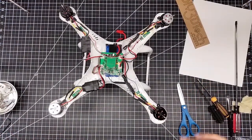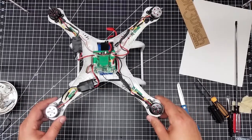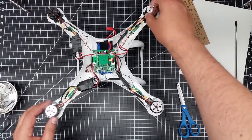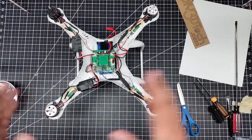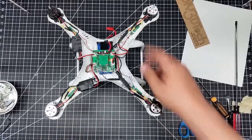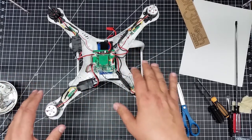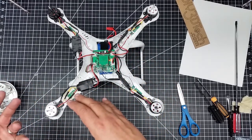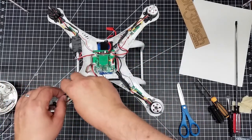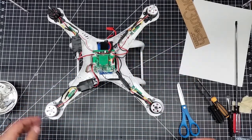Welcome back. So I swapped the motors around — this is the front of the copter, so black and black, silver and silver. We needed to swap the motor positions. Also, as I was working on it, I noticed more wires coming loose. The loose bullet connectors were even more of a problem than I initially realized.